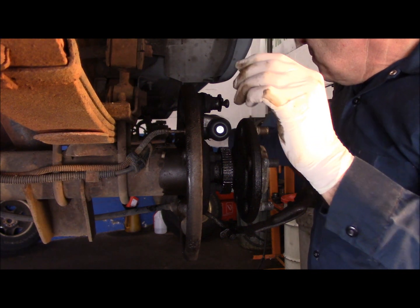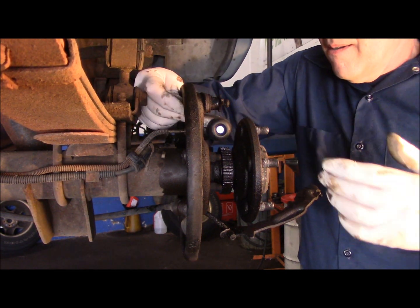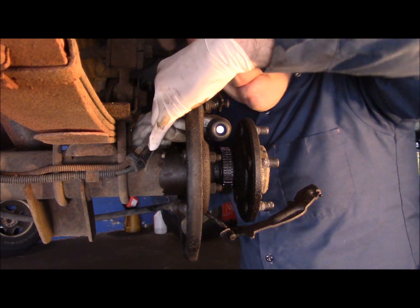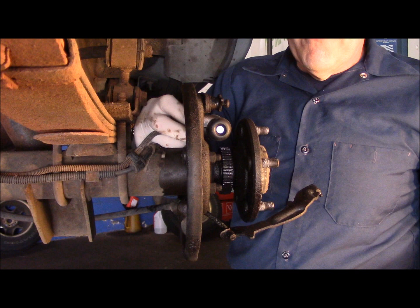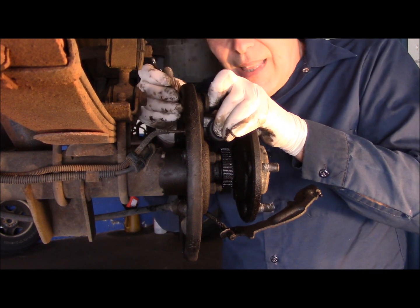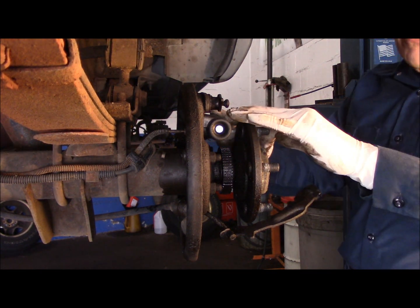Okay. So now, both our bolts are tight, and the line coming into the back is tight. Next thing we're going to do now is we're going to put that bleeder valve back in there. Now, before I tighten the valve up, I usually grab the wheel cylinder here and push it in. Push it closed, and then I snug that line up. Then I snug up the bleeder valve in the back. All right? Now, the wheel cylinder is finished.